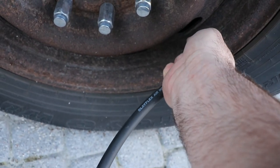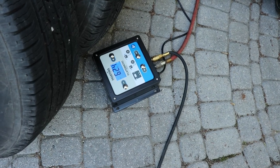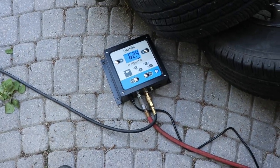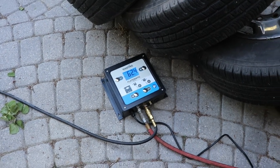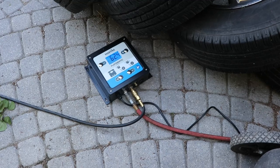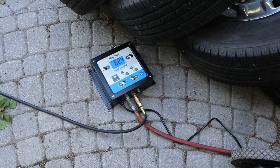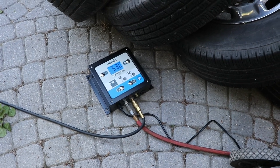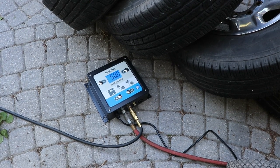Let's see what it does to the truck tire. It was at like 60-something, so it's going to deflate that tire and I'll have to come back around and pump it up again. I'm really happy with the way this is working. If this thing lasts like it should, I'll be very happy. It's IP66 rated, so in moderate climates you could leave it outdoors year-round — I think it was good to like minus 10, it's in the manual. It's taking a pressure sample now — yeah, it's at 53, so it dumped about 9 psi. That's a lot better than trying to stick a key in the tire valve to deflate it.